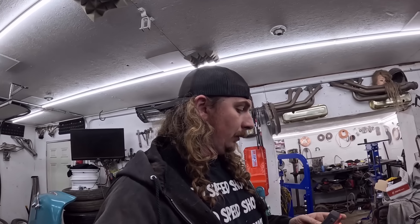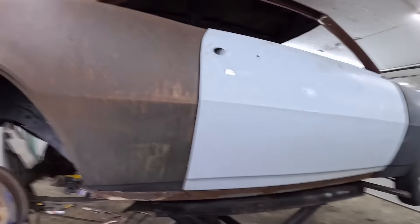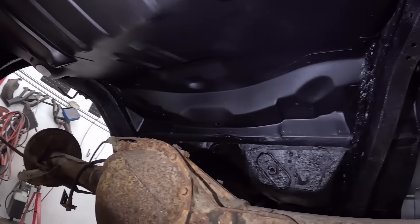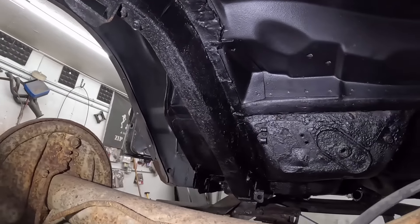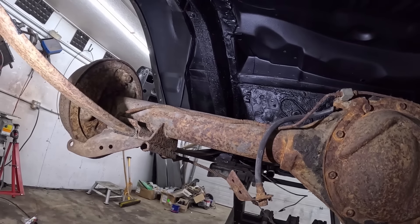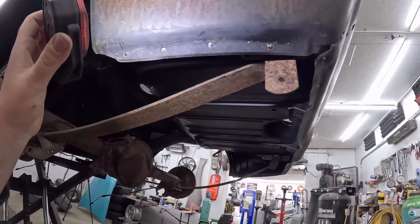Fast forward — I'm not going to lie, I had dinner. It was important. This is what we got going on now. I gave her a quick undercoat so you can see. Looks pretty decent. A lot of this stuff, we put some of that rust converter on first, let that kind of flash off, and then went over it with a little bit of undercoating. We're not going to go perfect, but look how much better this thing looks now with just a little bit of paint on it. Again, we're not hiding nothing — it's all very there. But there you go, it just looks better. It kind of paints the picture of what you're going to get. I would recommend if you're going to hot rod this thing, maybe a set of frame rails, but if you're looking for just a driver you're going to have fun with, no big deal. This thing will pass inspection here, I think, just for a daily driver.